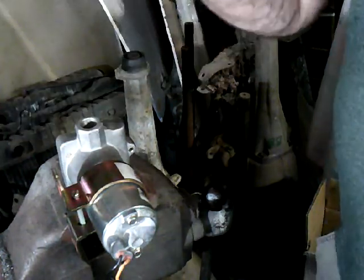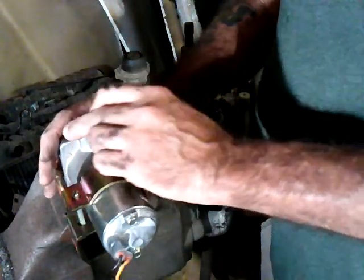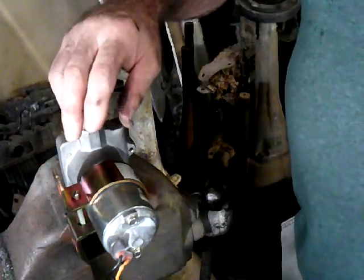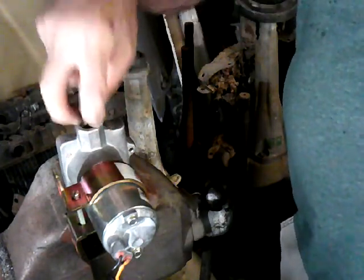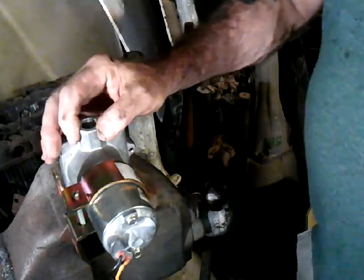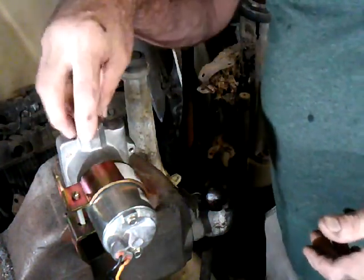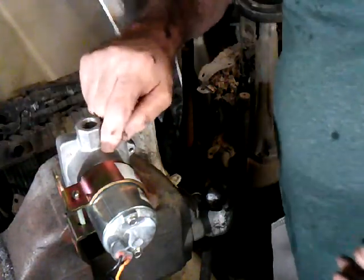Anyway, one of the number one things you got to remember is when dealing with carburetors or aluminum fuel pumps, or anytime you're using a pipe fitting, a pipe tap fitting, or pipe plugs, anything that's a tapered fitting. The way a pipe plug works is it's actually tapered, and that taper goes down inside here and it gets tighter and tighter as it's going in. If you're using aluminum, you can over tighten it and you'll end up cracking your housing.